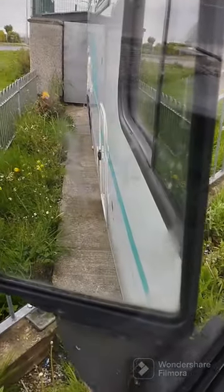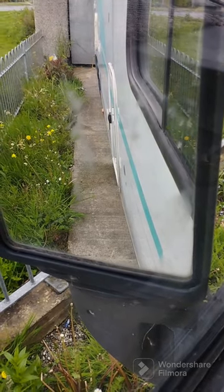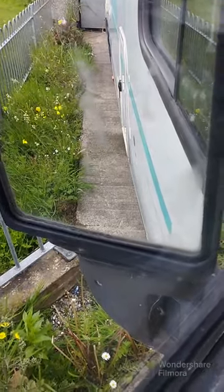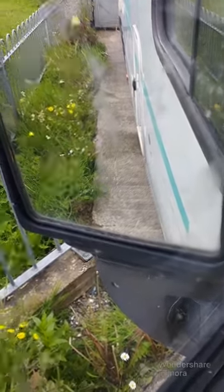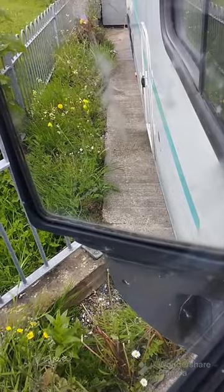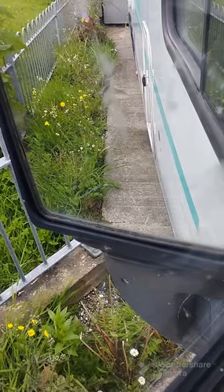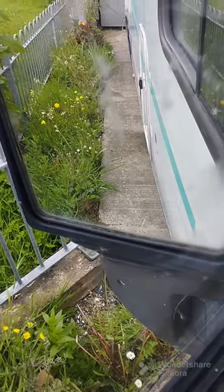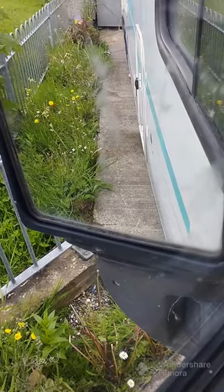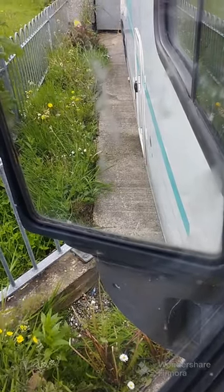Right, so now we've added the Dipotane. So what we're going to do is we're going to start the van. Now it's just after been bled, so whether it'll start up straight away, we'll see. So we'll just turn the ignition here and we'll see. As I said, now remember, my van is hot, so there's no smoke. We're going to leave this run now for about 20 minutes, and then what we'll do is we'll start it when it's cold tomorrow, first thing, and we'll see the difference.